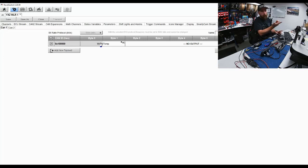And then you have small things like asking for the low byte. If it's in Big Endian, it is the furthest right byte on the byte map. So this would be the low byte of information. This is where your small digits are going to happen, your decimal places, your 1 position, your 10 position. And then this is where your large information is. So if you think about the way a number is written, we read 100,000. The low byte would be here. The high byte would be here.